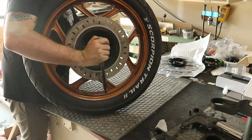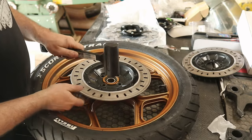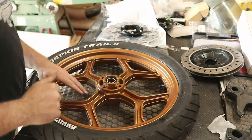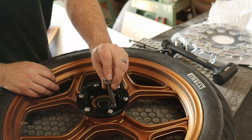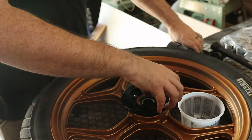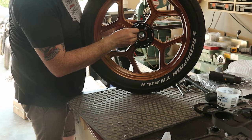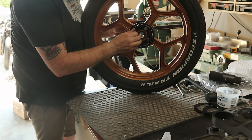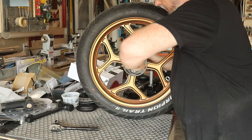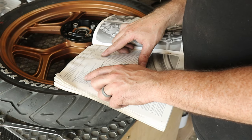The conversion was a lot easier than I thought it was going to be. I planned about a day to do the work, but setting up the front wheel and swapping the forks probably only took a few hours. It's the bleeding of the brakes and the rewiring of the handlebars that took more time. Starting with the rotor adapter kit, there are two plates that get mounted on each side of the wheel — these are what the disc brakes mount to. They also have a retainer ring for extra support on the rotor. The retaining rings need to be removed before you add the inner plates, and it works with all the stock hardware, which makes it a very plug-and-play system. Once everything was snugged up, I referenced the manual to make sure I was using the right torque specs.